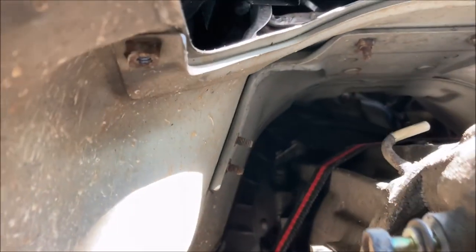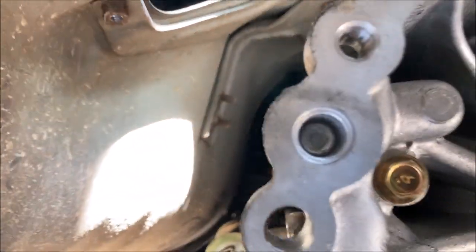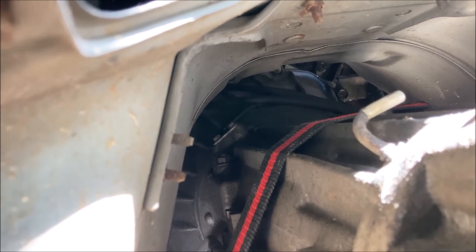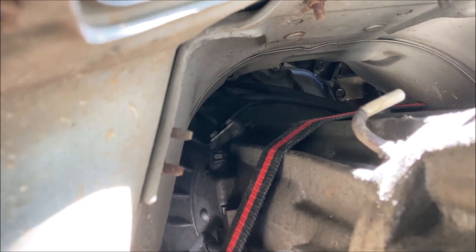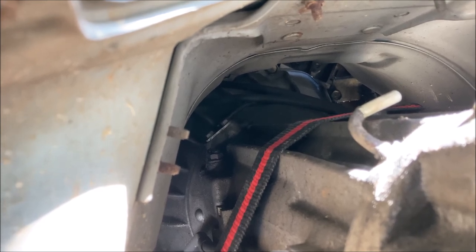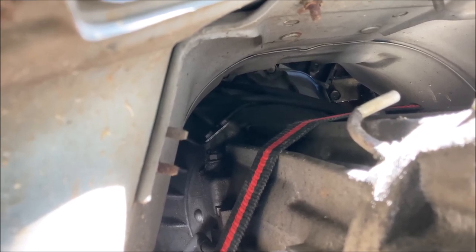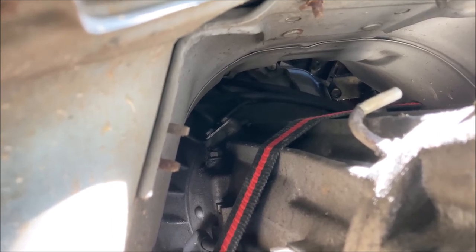We're going to see about accessing some bell housing bolts up in the front. By dropping the transmission down slightly, you begin to gain access to these. You'll just want to make a stack of extensions to snake up in there and get those. Those should be 14 millimeter bolts. I would suggest starting with the top and the sides first before doing the lower. Those are the hardest, so start with the hard first and work your way down to the easy stuff, and you should be okay.